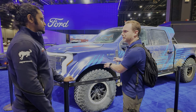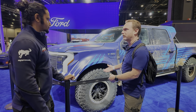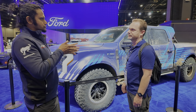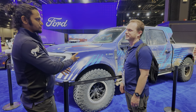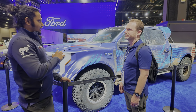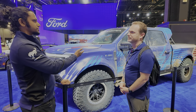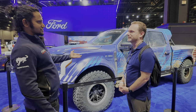It's an e-demonstrator, and it actually translates back to the regular production vehicle too. It's really hard to figure out all the minutiae — frame loads, durability loads, what the primary drive unit axle interface sees in terms of loading when you do these things. Those are really hard to predict. We have some data from other off-road activities, but we haven't done that with a BEV where the weight distribution and actual weight is completely different. All of those things change your loading conditions. In fact, just tomorrow we have a meeting with the Lightning road car team to discuss something we found in the primary drive unit area based on new loading data — and we're only two or three tests in.